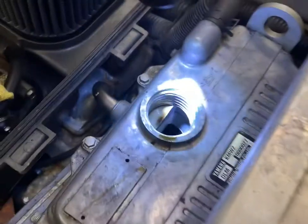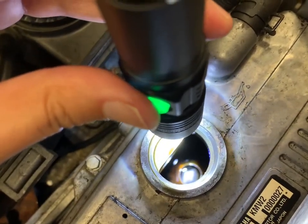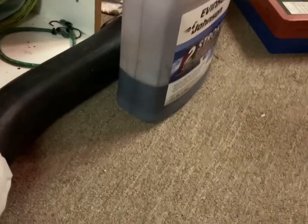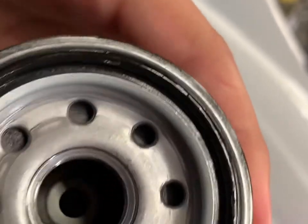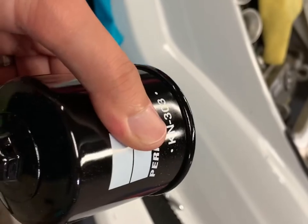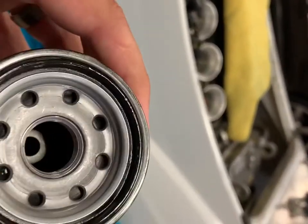It sucked all the way down to the pump — it's bone dry. I just purchased this ski and only took out one and a half quarts, so it was definitely low on oil. The new filter comes pre-lubed already — as you can see, the ring is already oiled up, so you don't have to oil it yourself. I put just a little bit of oil in it anyway so the ski doesn't dry start for too long.